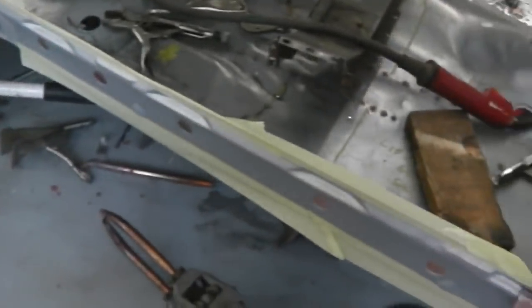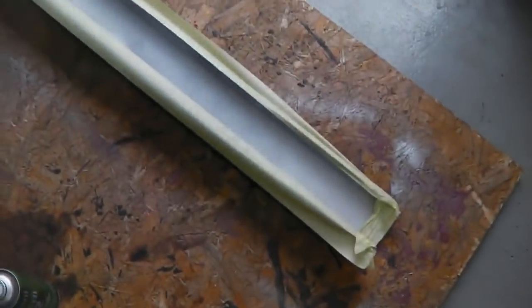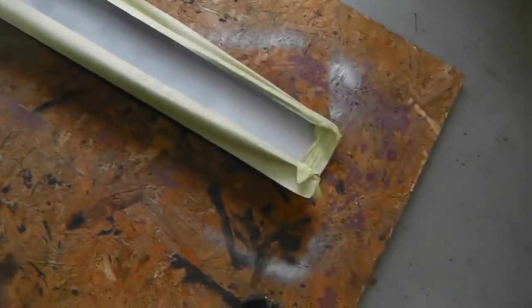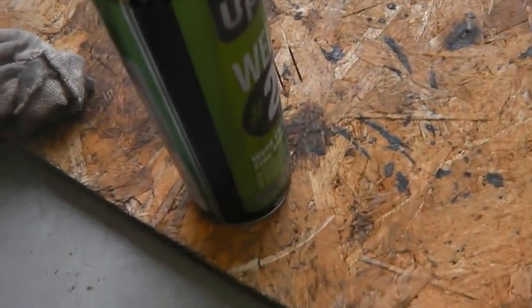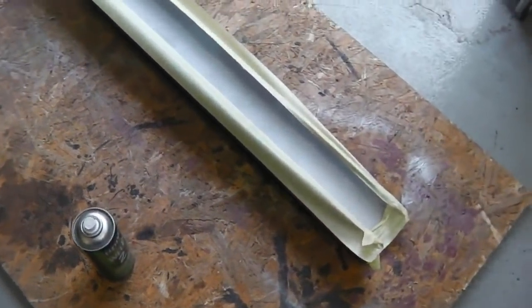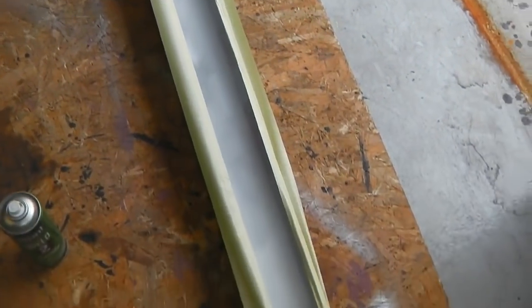Getting close to doing some painting. Over here's the sill. Door is open because of fumes. Mask will be going on as well. So there's two layers on there, three layers on that. Weld through, a zinc weld through. That zinc weld through as well is on. And now we use Technogrip, which is also zinc based, so there you go, we'll get that painted.